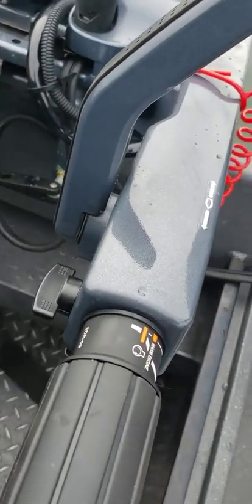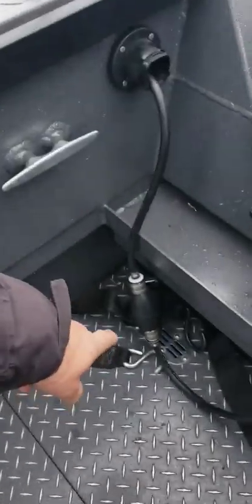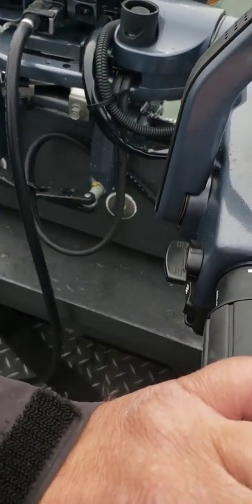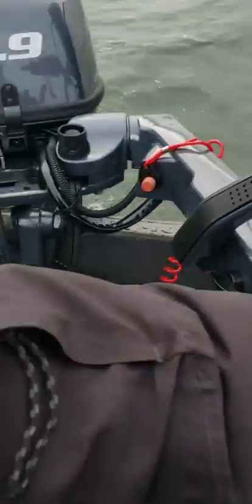You've got a friction screw here, so if you want to lock it out you can lock it out here and move it like this. On cold starts you'd pull that out, bring it up, make sure you pump that primer bulb, and then hit the start button. Since I've already started this, you don't need that choke - put it in between these two, bring it down, and put it in gear.